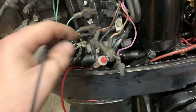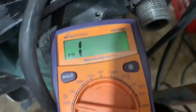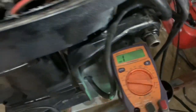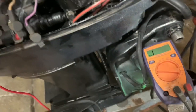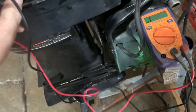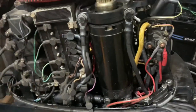Next step is checking all of these wires to ground. I'm going to use this as my ground. That wire is hooked up and I read infinite resistance — that's good. The next one: no reading, infinite — that's good. The white wire: infinite — that's good. Purple to ground: we read infinite. So the trigger is in good shape. Trigger passes.